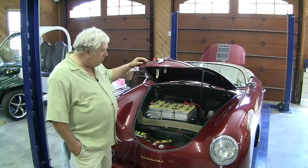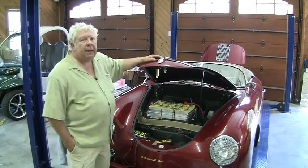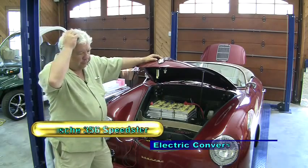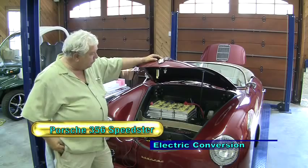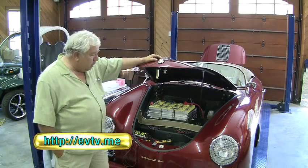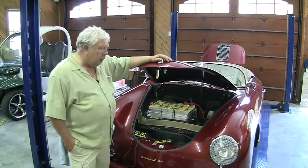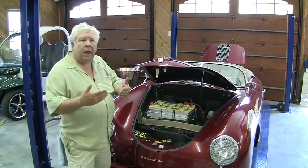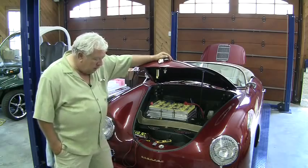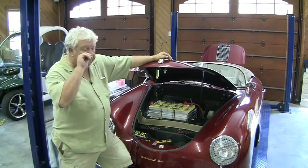What we've found is that these batteries are actually quite well in balance and very small variations can be made to show up fairly effectively. Our first line of defense is a very simple display on our eVision system. Lee Hart, a veteran of electric cars for many years, described this circuit some years ago and it's online. You basically take two halves of your pack and put them across a bidirectional LED, and if one voltage exceeds the other by more than a few tenths of a volt, you'll start to light the LED.